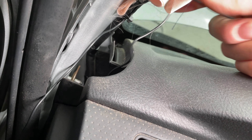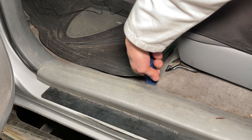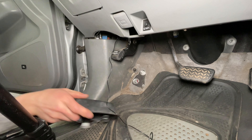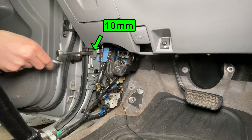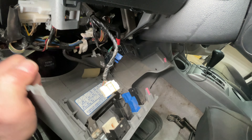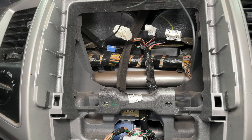Next I'm dropping the wire straight down into the dashboard. The A-pillar trim slides into the dash at the bottom then snaps into the metal at the top — install two bolts then the covers. I'm removing the driver's door sill trim by pulling it straight up with a plastic pry bar. The little footrest comes out by pulling on it, then you can reach the plastic nut that holds the kick panel. Pull the panel straight toward the back of the truck. Remove the two bolts holding the lower dashboard trim, pull out the storage bin, then pull the whole panel straight back. I routed the microphone wire up over the fuse panel then taped it to the metal plate under the steering column, and finally pulled the wire up into the radio compartment in the dashboard.